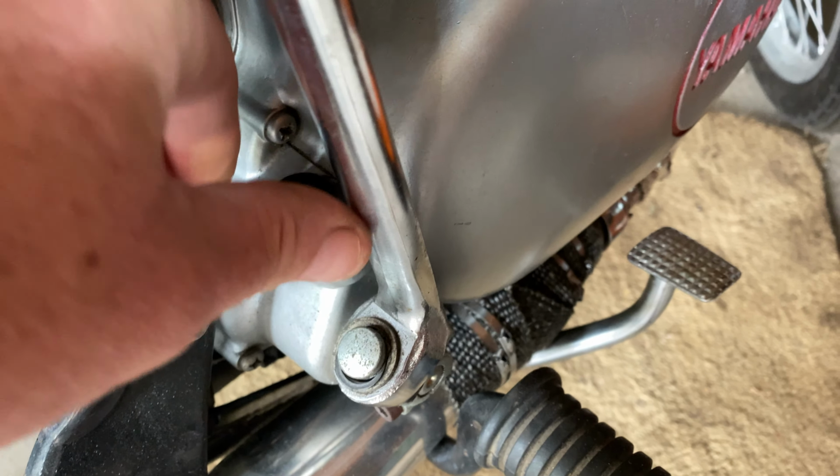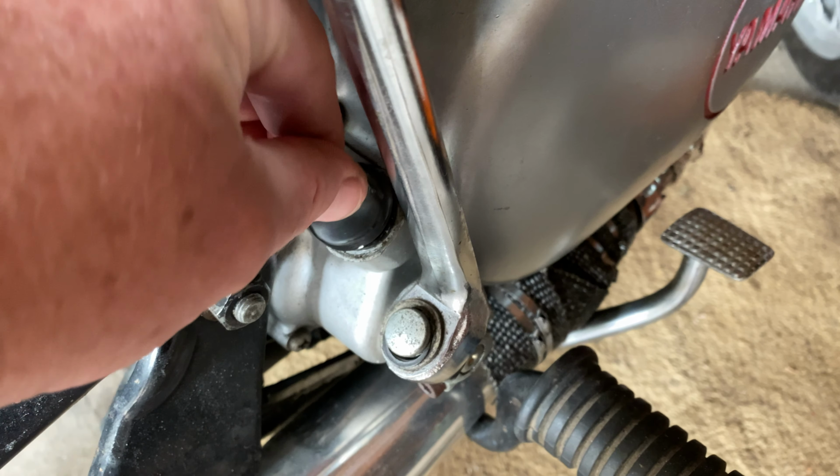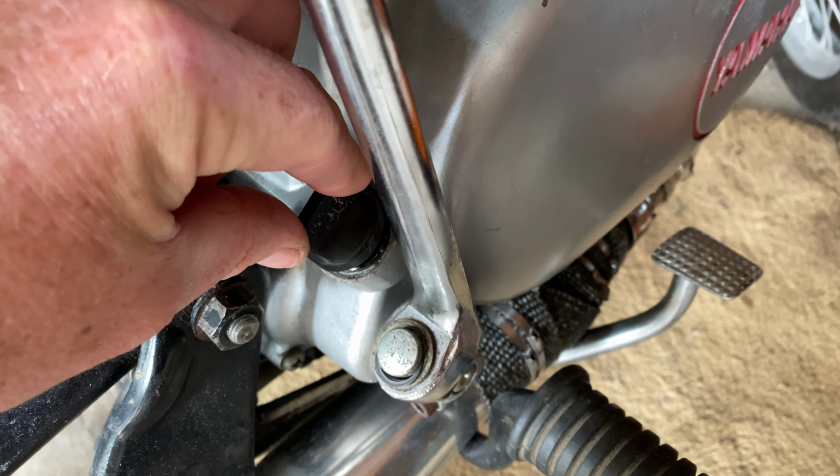So backspinning a bolt, or turning it in the opposite direction. I'm obviously not trying to tighten this. That's how you loosen it. But if you loosen it to the right point, the threads will drop in and align themselves. Listen. Aligned.